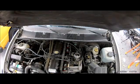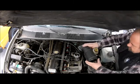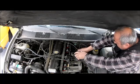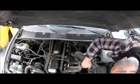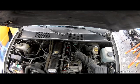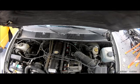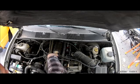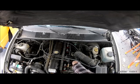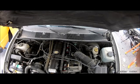Let me reassemble everything. And that'll go slow. Alright, so we connected the other stuff up. This one, make sure it's in here. Slip it on there, slip the intake on, ratchet them closed. Last one is to take the PCV valve, slap it over here, plug it in, and then the last thing I do that I got out with a screwdriver is snap these in place. Now the engine's good to go.